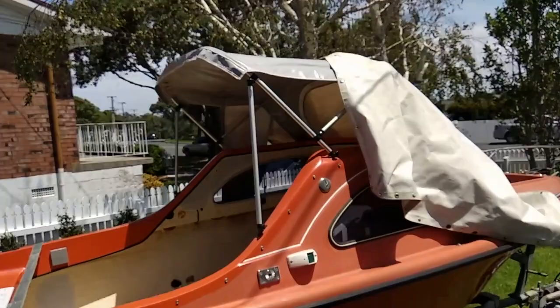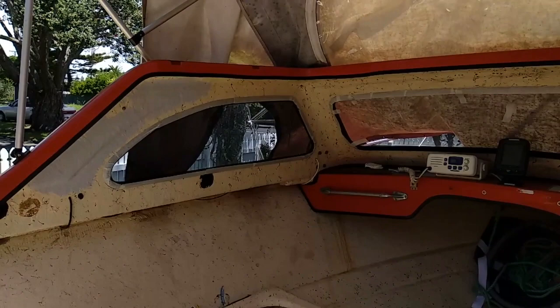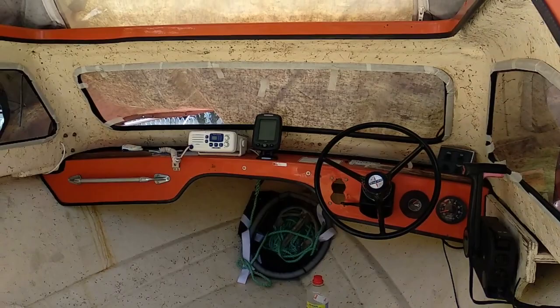I went with triple concrete, which is basically the colour of the canopy, so that should match. You can see I've done a couple of tests inside already and adjusted the colour since then to be slightly lighter. So I'm going to mask the vinyl, the rubber surrounds of the perspex, clear away the dash area, and start by painting the area at the top.